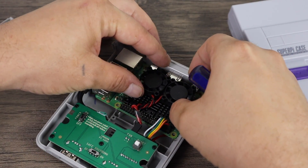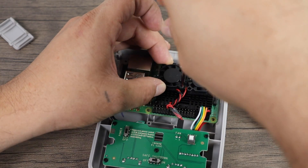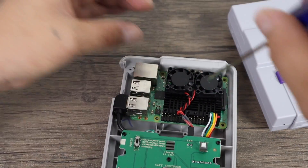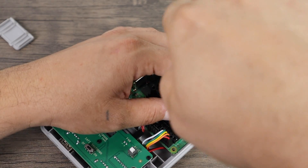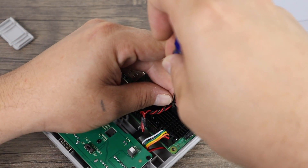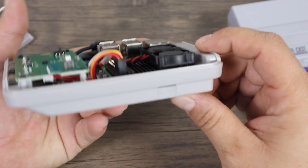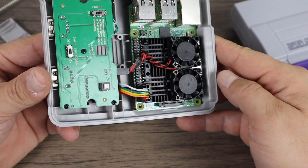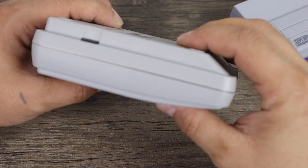Now that we have all eight screws removed, we're just going to move the fans back and we're going to be using two screws for each fan. It's not going to be blowing directly on the heatsink, but it will circulate airflow. I've also done thermal tests using no heatsink, the copper heatsink, and this dual fan heatsink — I ran a 10 minute test running PS1 and I'm going to show you that in just a second. The lead is a little short for the SNES style but they do sell JST extensions — links are in the description.